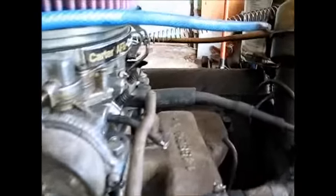I noticed the other day when I hooked up the PCV valve it seemed like it ran really well — it didn't smoke nearly as much. But I had it on a pretty smallish line right here. That's the one that goes in front of the carburetor. There's a much larger opening in the back of the carburetor that is actually probably for that, and I didn't have a fitting fit in there — that was just plugged off.